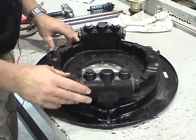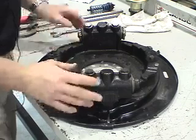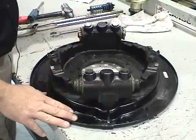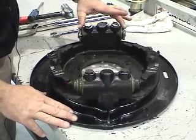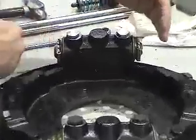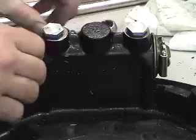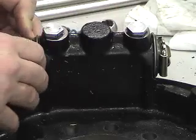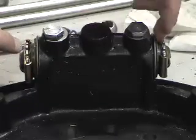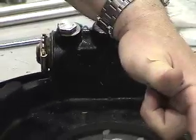Now we're going to remove the plungers from the plunger housings. You'll notice on this, because it's a single actuator, both the adjusters are on one plunger. That's so that as the actuator pushes on the wedge, it pushes the plungers out. And because there's only one side being actuated, we need to have both adjusters on it. So both anchor pins will be on the opposite one.